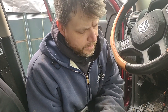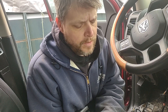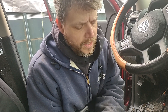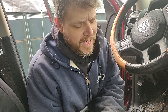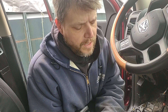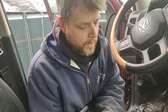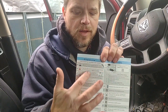So wait for the LED to turn solid red, then turn the key to the off position and remove the key. Insert the key and turn it to the on/run position again. Wait for the LED on the remote start module to flash green and remove the key. Then disconnect the remote start module from the T-harness, disconnect the black connector last. So while I'm still waiting for this to turn red — we did all this, and now we're at the programming step.